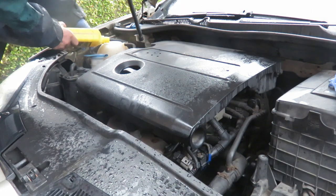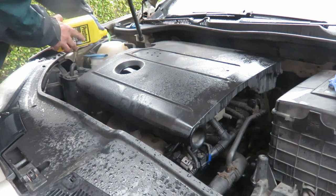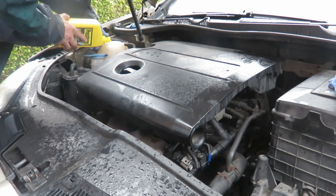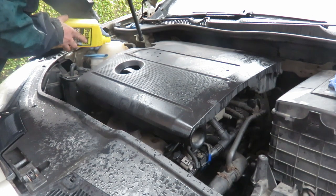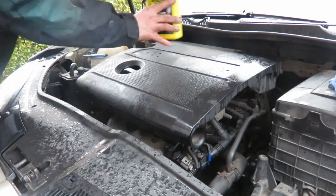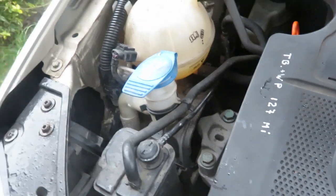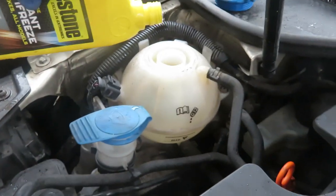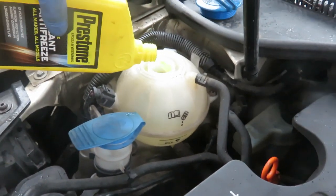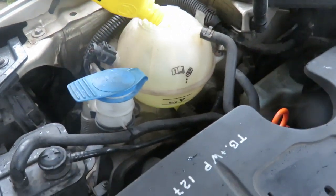When you are topping up the reservoir, just be aware that you may have to keep topping it up a few times as the water in the reservoir circulates through the engine where you have drained it out. What I did was fill up the reservoir, turn the engine on, and then keep topping up the reservoir as the water was being pumped through the system by the water pump. Turn the heater on full blast in the car as well, just in case some of the water has drained out of that area — it needs to be opened up to allow it to refill.